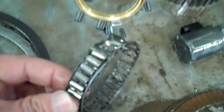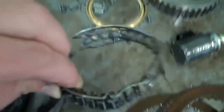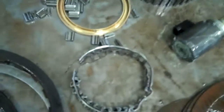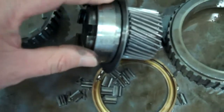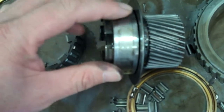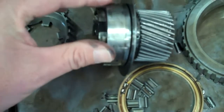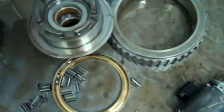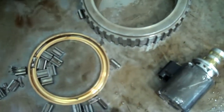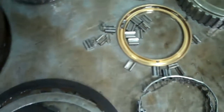This here is pretty interesting. You can see it's completely torn up on these roller bearings. And what's happened is it's caused this — it may be a little difficult to see, but look at the color there: see how it's shiny on the right and left, and the middle is kind of cloudy? That's the race on here, and this is pitted — it's completely all pitted up. It's just torn up.